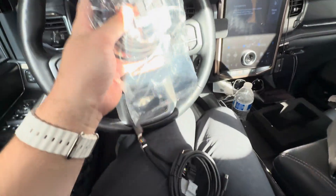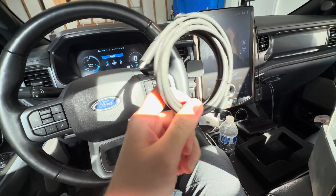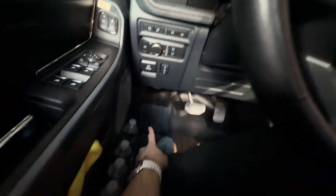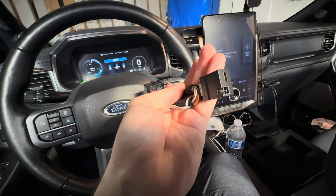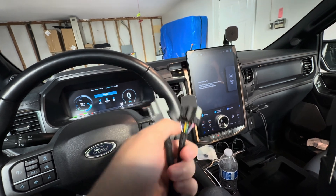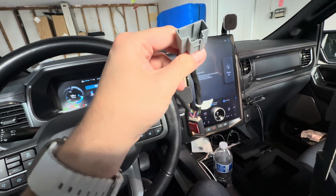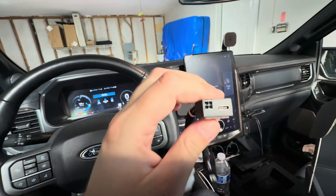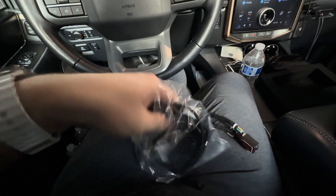Here we have the Comma power cable to provide power to the unit. This is a long USB-C cable — they're using it for the OBD data — that we're going to run basically from here all the way along the windshield and then down. That's how it actually interfaces with the car. This is the harness needed for this car specifically, so this intercepts the vehicle communication. One end goes into the existing IPMA — Image Processing Module A — and then this injects signals in there.